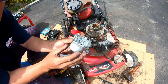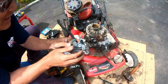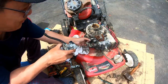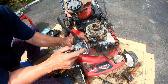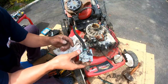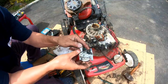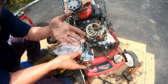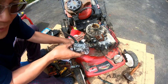So I finally cleaned this carb as well as I can, but then when I was ready to put this on, I saw this part was still on the throttle linkage — I had actually broken it. So I just super glued it. As long as I can attach this carburetor onto here, there's no heavy torque, as long as this moves, that's all it does. It doesn't matter if it's cracked, it'll hold as long as I get it on there right.